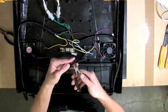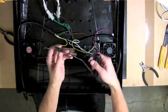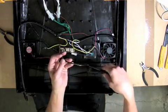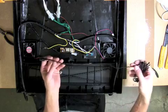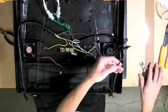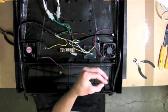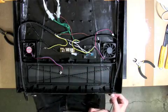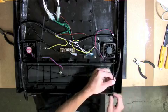Remove the DC jack wire bundle from your included parts kit and unbundle the wire. Using a pair of wire cutters, trim the DC jack bundle to approximately 12 inches in length. Insert the trimmed DC jack wire through both of the holes drilled in the back of the canopy.